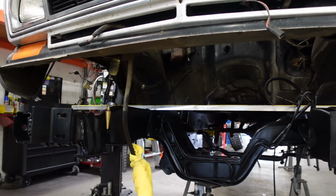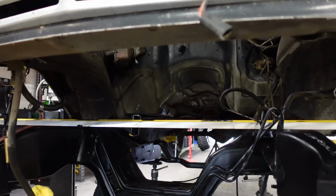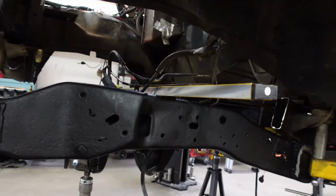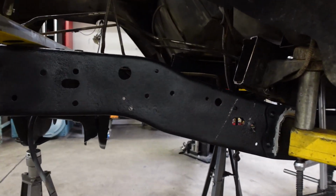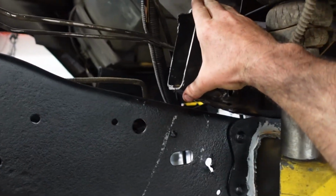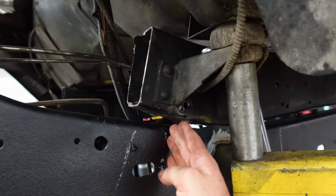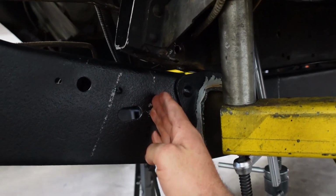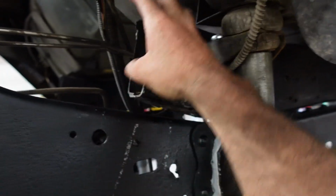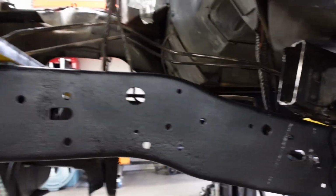All right, this is where we sit for day one. We got the Jeep frame out, the motor, the transfer case. We're kind of playing around with the F-150 frame. It's looking like the F-150 frame is literally going to overlap the Jeep frame, like it's a match made in heaven. Probably cut it about here. And then we're gonna maybe trim this mount here and then slide it over about 3 inches and obviously plate it all up. Tie everything in.